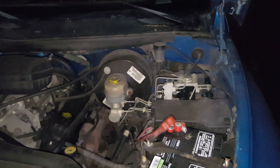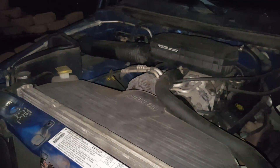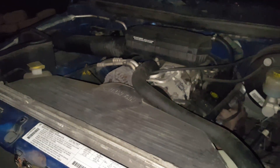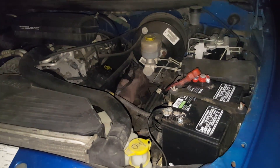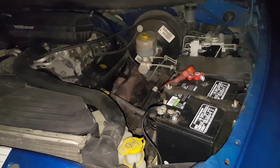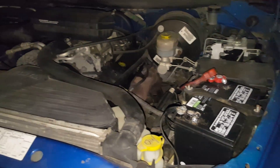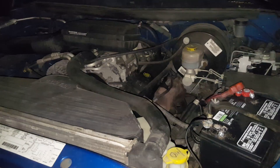So that is it. Hopefully this helps someone. This is for anywhere from a 94 to 2001 series Dodge Ram, at least the 1500. I believe all the others are about the same, but I'm not 100% sure — I know it works on a 1500, and it has to be 2000 or older, so that would be the 94 to 2000. Because in 2001, they changed to a different emissions system that uses the same coding as the California emissions system. This truck was from California but apparently had the federal emissions system, which can use that bypass.